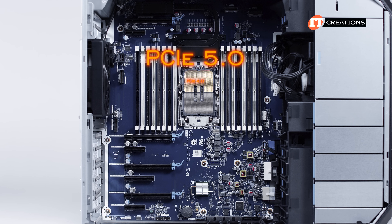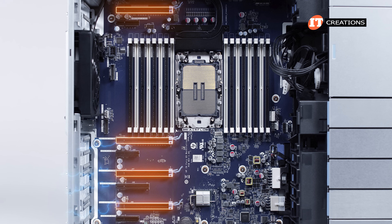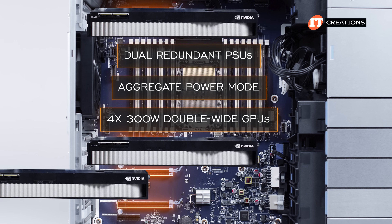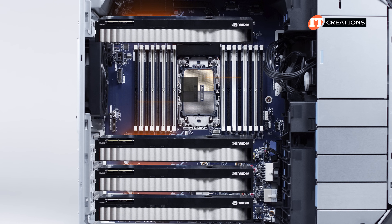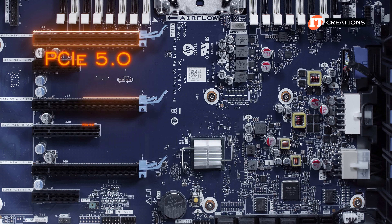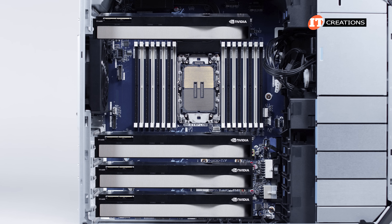The system has a combination of PCI 5.0, 4.0, and 3.0 slots — on the previous generation it was only PCI 3.0, so a definite upgrade. Another nice feature is the additional space between the x16 PCI slots to ensure the GPUs receive adequate cooling. Some of the supported GPUs will require additional power cables. You will need the dual redundant power supply units running in aggregate power mode if you plan on loading up with four 300-watt double-wide GPUs, plus the wattage required by the CPU which can be up to 350 watts. The more powerful GPUs also require 12-pin power connectors, which are not a problem on this next-gen system. Only the two x16 slots above the CPU and the one directly below are PCI Gen 5; the other x16 slot is PCI Gen 4, but that's not really a problem as the RTX A6000 has a PCI 4.0 bus interface. With four double-wide GPUs mounted, the short-length PCI slots in between are completely covered.